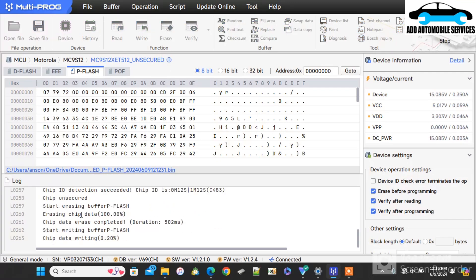I'll write it onto the chip and see how long it takes to write data on it. With this board, if I have such a job I can easily read and write the P-flash onto it. You can see how slow it is. Normally when you're using MotorProg to write data, it will write all the data, but the moment it compiles and sees that the data is the same it just runs through the sectors and tells you all the data is the same — so it reads faster. But if there is a change in the data and you are writing, it takes much more time.